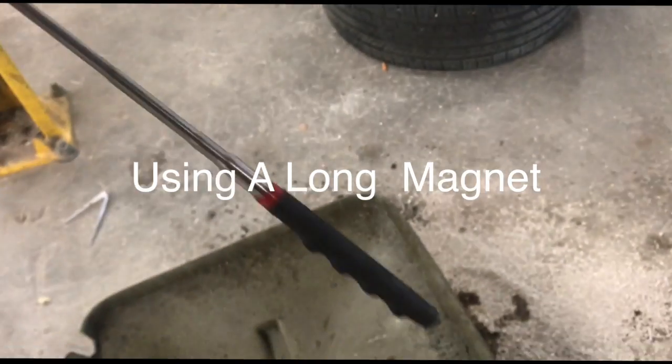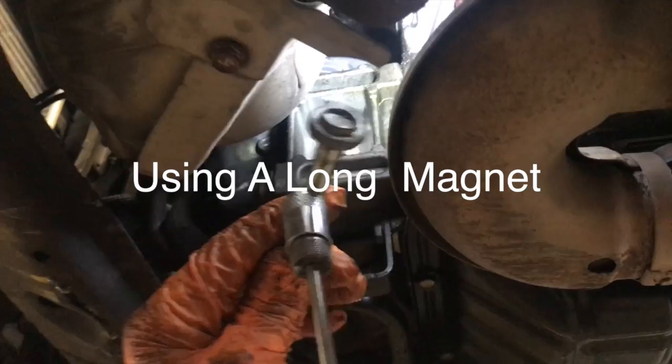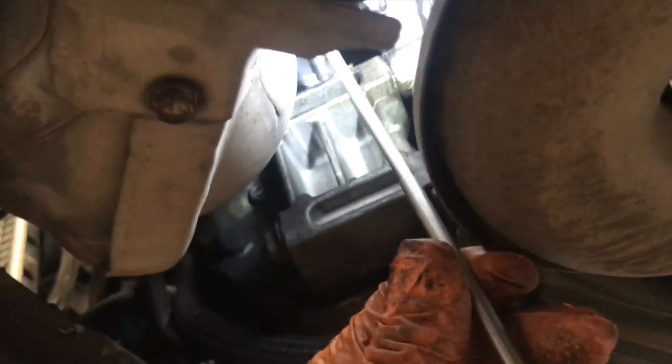Keep in mind we still have the exhaust manifold installed and we never removed the compressor, so it's kind of a tight position. So I used a telescoping magnet just to get the bolt started into the lower alternator housing. And the video is going to get a little bit, well, you can't really see because it's a tight situation, but I'm basically taking one hand, pushing the rear lower alternator bolt through as I'm wiggling the alternator, and then the front bolt is going to pop out.